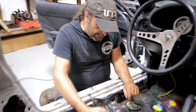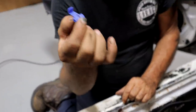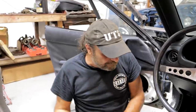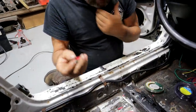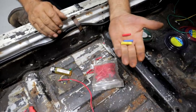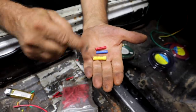About 25 years ago, solderless connectors started popping up. But before those, guillotine connectors came out — you'll find these in a lot of trailer install kits. Don't ever use these; there's never a reason to. They're really bad, and in my mind they fall under the same heading as electrician wire nuts. The solderless connector is the magic wiring cure-all. They come in three common sizes: the red, the smallest; the blue, the medium; and the yellow, the largest. In about 75% of automotive applications, the red one is going to match the wire you're using.